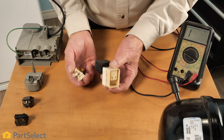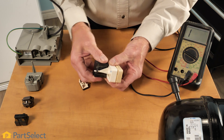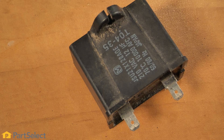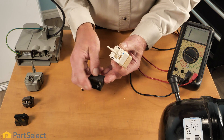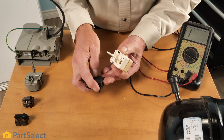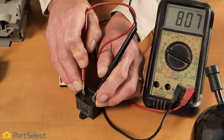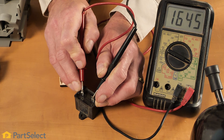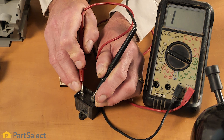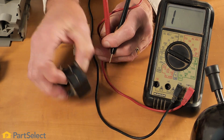The three typical components of a relay start device would be the capacitor, maybe called either a run capacitor or a start capacitor. About the only thing that you can check on these is to verify that they're not shorted. The numbers will typically rapidly change and then go to an overscale condition. That test simply means that the capacitor is not shorted and is not open.